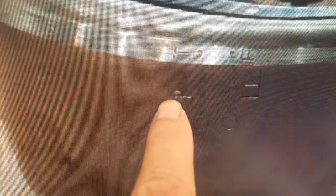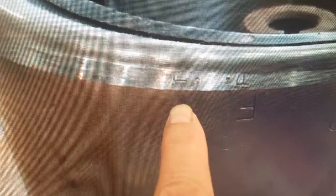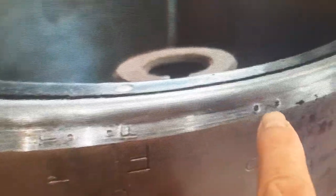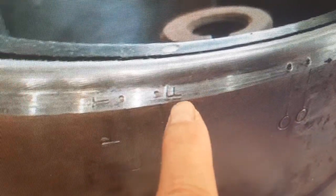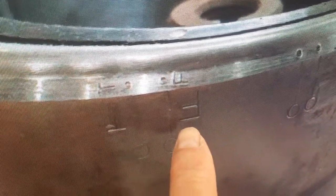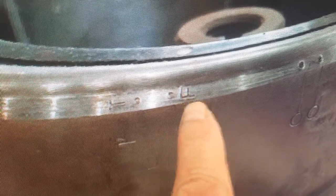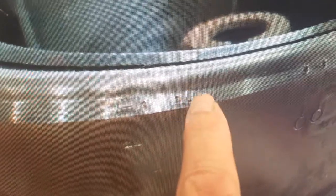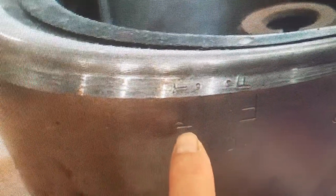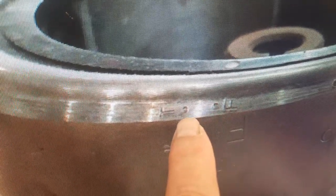It's real obvious on the top of the flywheel that you can't see through the opening — you only see these. So basically, if you look for the two dots, the first mark is the firing mark, which could be confused as the T mark because that sure looks like a T to me with a mark beside it. But it also looks like an F when you get your brain wrapped around it. And then this is the T, the timing mark. So these little dots are the marks.